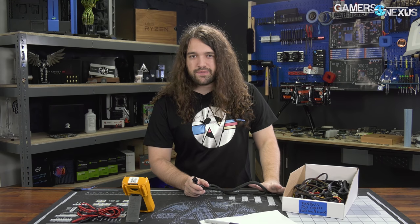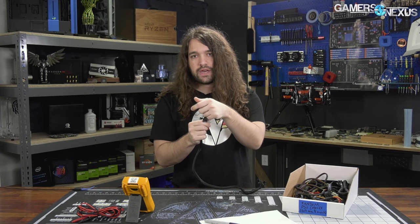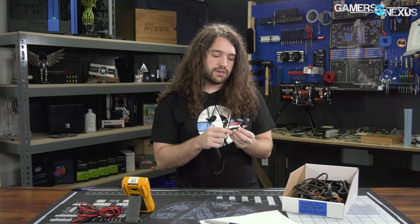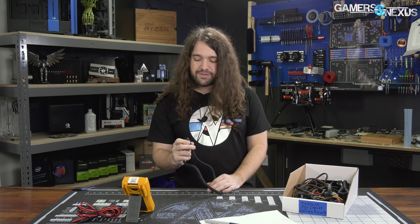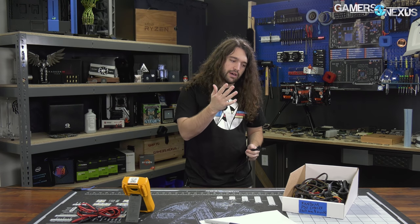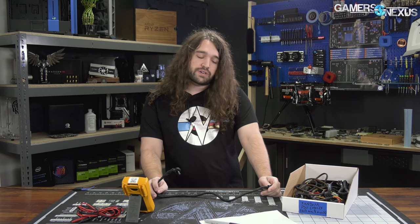Here's the quick version of our previous video — we'll put a card on screen, you should watch it. The power supply side of the cabling has a key, meaning the edges of the pins are chamfered in different ways so you shouldn't be able to mix and match. But that doesn't stop people, because manufacturers just buy whatever connectors and match them without guaranteeing the pinout is the same. You might have a 12-volt line where normally there's a 5-volt, or a 12-volt where there's a ground — which is bad. For example, mixing a SATA cable from a Corsair PSU onto an EVGA one could kill the SSD or damage the system.